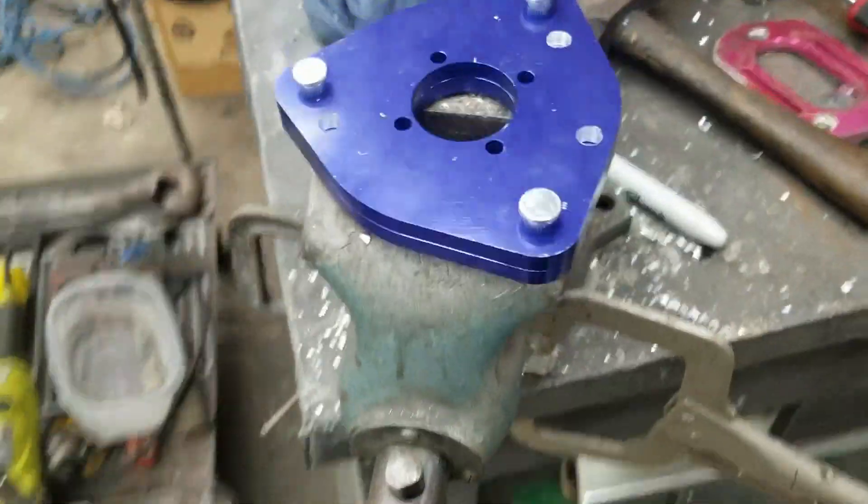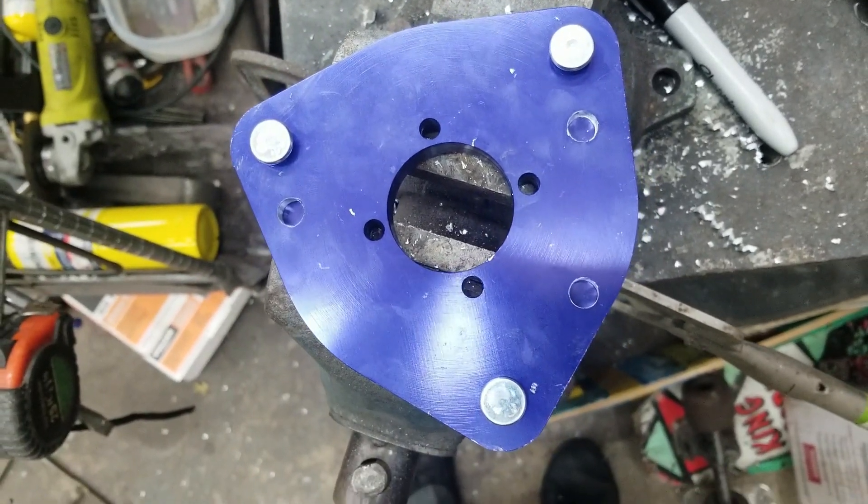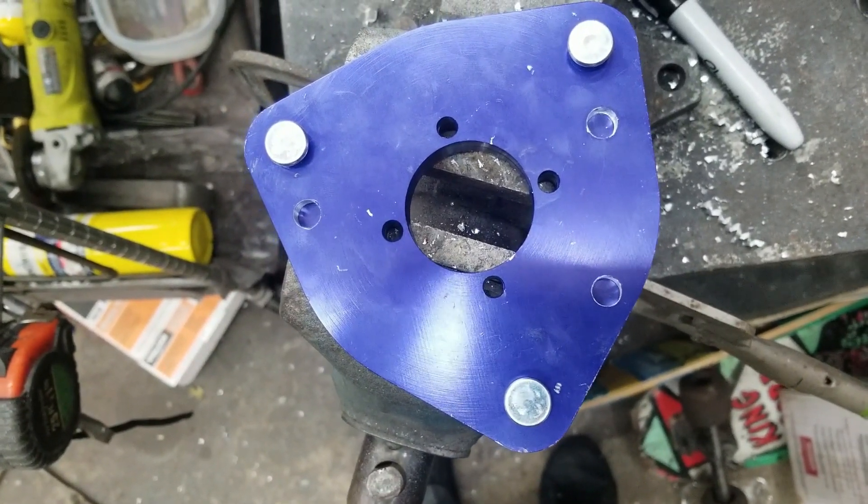I got all the holes drilled on the first top hat. A little trick I like to do on the second top hat: since they're both the same piece, I bolt them together, which gives me a template to perfectly match from one side to the other. Now I can just drill through those holes and have both front top hats already modified and ready to go. I just need to drill three more holes, then pound the studs back in. The front top hats will be all set, and we use the stock rear top hats in the back.